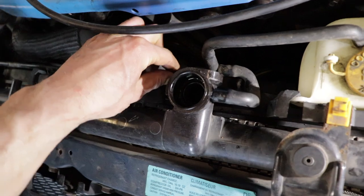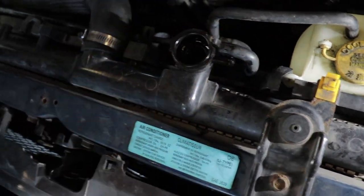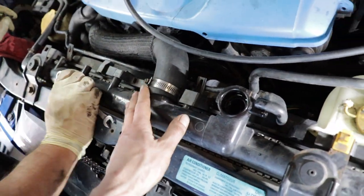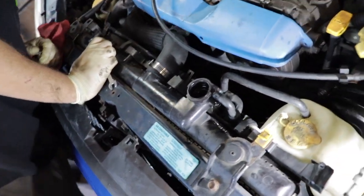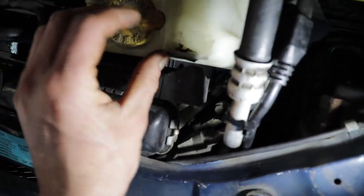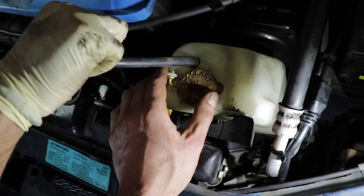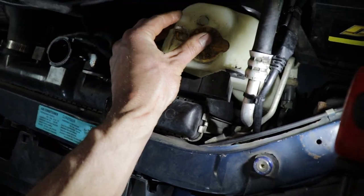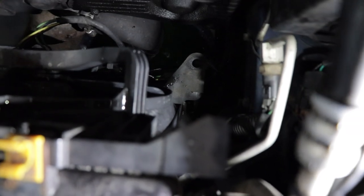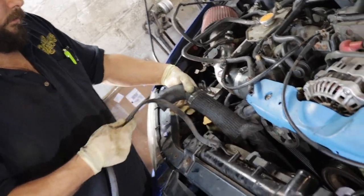The 10mm bolts hold on the fans and this coolant hose that goes to the overflow bottle and the top neck on the radiator. Easiest way is to pull the fans out first — you can do it either way, with the fans on or off, but you'll fight a little more with them on. For the overflow bottle, there's a little tab you push in and it pops out, but that was broken on this one so it was zip tied. Pull the hose out and the bottle comes out — it has a little stem on the bottom that sits in a hole.